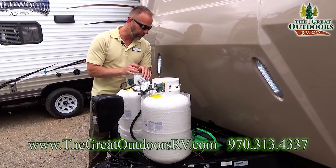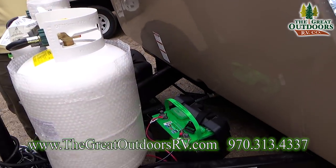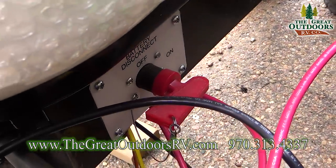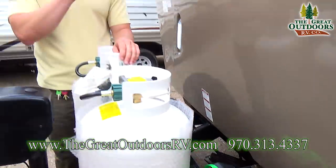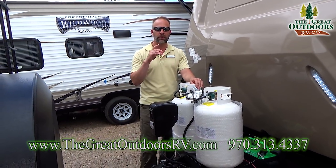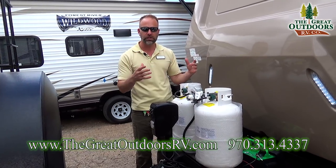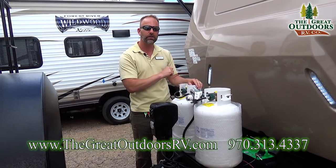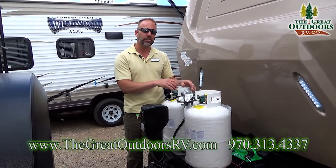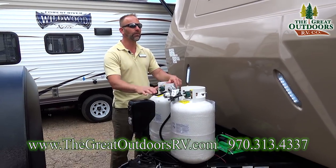You get a marine grade 12-volt deep cycle battery with the purchase of the camper. The battery disconnect — which I call the thousand dollar part — turns off all battery power to the coach when you don't want to use it. Why is that important? Because you have an LP detector inside the coach that continues to run 24/7. Even when you think all your power is off, that detector is still running. The only way to turn it off completely is to disconnect your battery or use the battery disconnect.